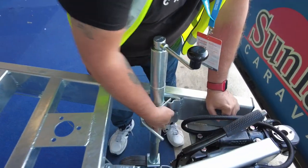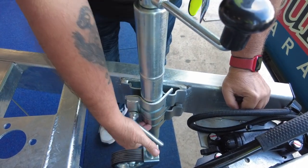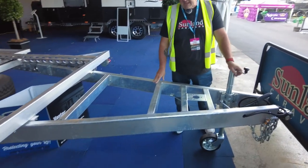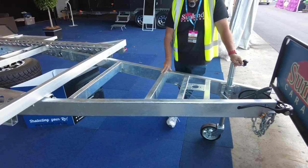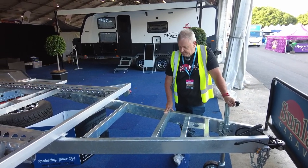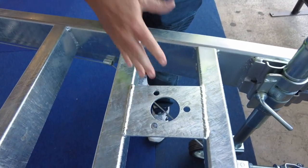We also have a ratchet handbrake and a double wheel clamp — the double clamping holds in two spots with only the one handle. Some do two separate ones with two handles but that's a bit messy. The A-frame is made of steel — hot-dip galvanized steel. The reason we use steel in this particular part of the chassis is that this is where I want the flex to happen; while you're travelling, this is the flexible part of the chassis, and it's braced correctly.